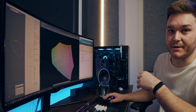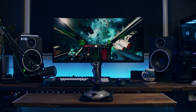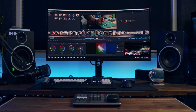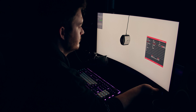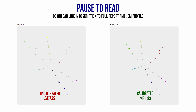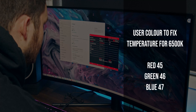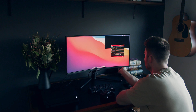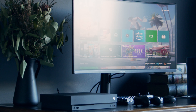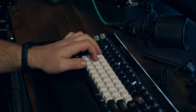Now let's talk colour accuracy, because it's not bad. It's rated for 140% sRGB coverage and 103% DCI-P3 colour gamut coverage, with a contrast ratio of 3000:1. Those are gamut volume numbers, which are great for enjoying gaming and movies, but if you're creating content and editing, the vital numbers are colour coverage. I calibrated the monitor three times over a couple of weeks using the X-Rite i1 Display Pro, and the results are pretty impressive colour accuracy for a monitor at this resolution and refresh rate at this price range. However, out of the box there's a noticeable magenta shift, and you can see this in many online photos and reviews on their site. The adjustments are stored against the input on the monitor, so I had to redo them for HDMI on my wife's MacBook Pro — a useful feature, because if you've got an Xbox on HDMI you can have different RGB values than your PC on DisplayPort. The picture-in-picture can also be easily moved around the display depending on which side you want. For a monitor not designed for colour work, I'd be happy to create content with it — I've edited the past couple of YouTube videos on this.